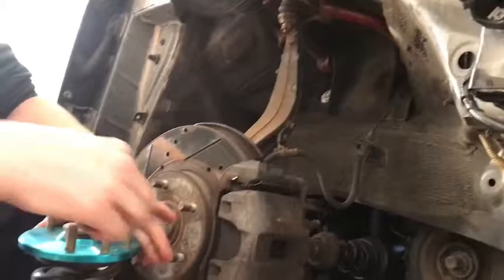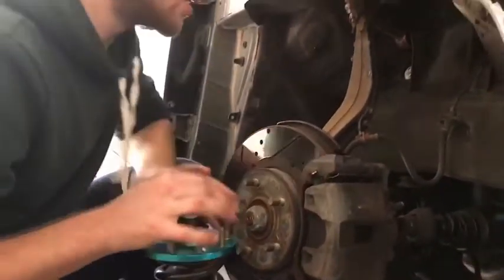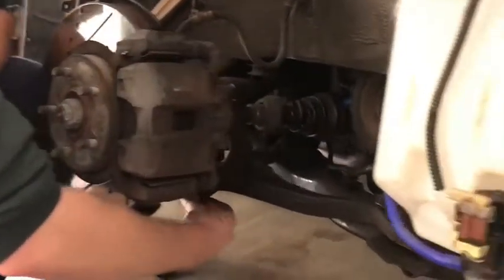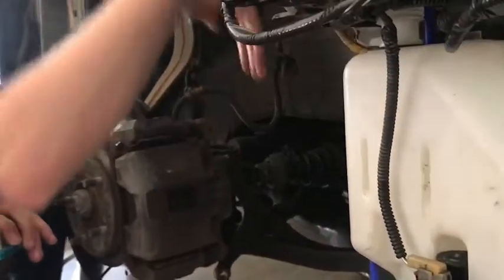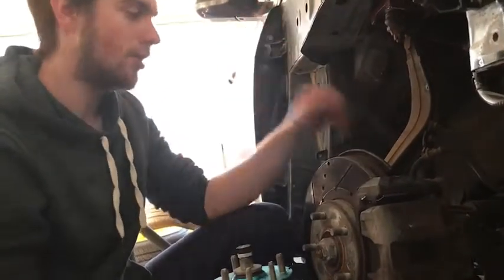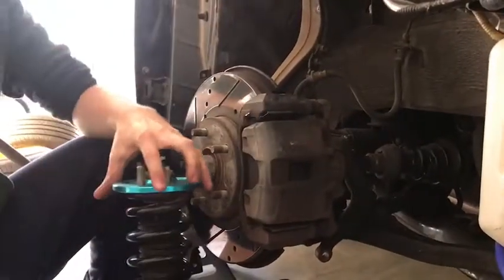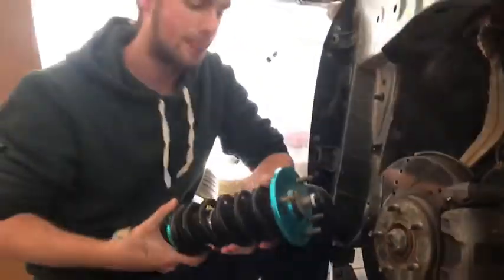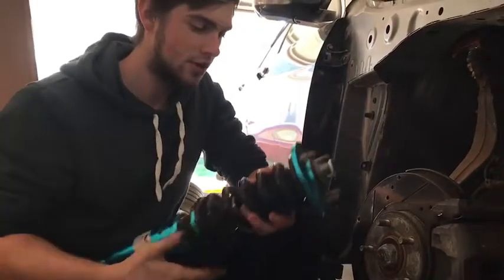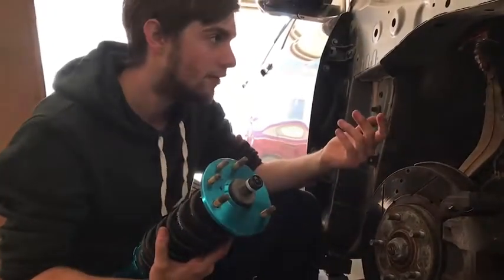In order to do that, you take the 5 bolts that are up here that I just showed you off, and then the 2 on the fork off, and the fork will drop down. You'll hold this up and then put some pressure on here to pull it down. See how it's pretty easy actually. And then it'll slot out from here, and you can kind of just swing this out. It's pretty easy. It's self-explanatory. You'll see it when you go to do it. And that's pretty much it. And now we have easy access to the 2 bolts up here, which I'll show you in a second.